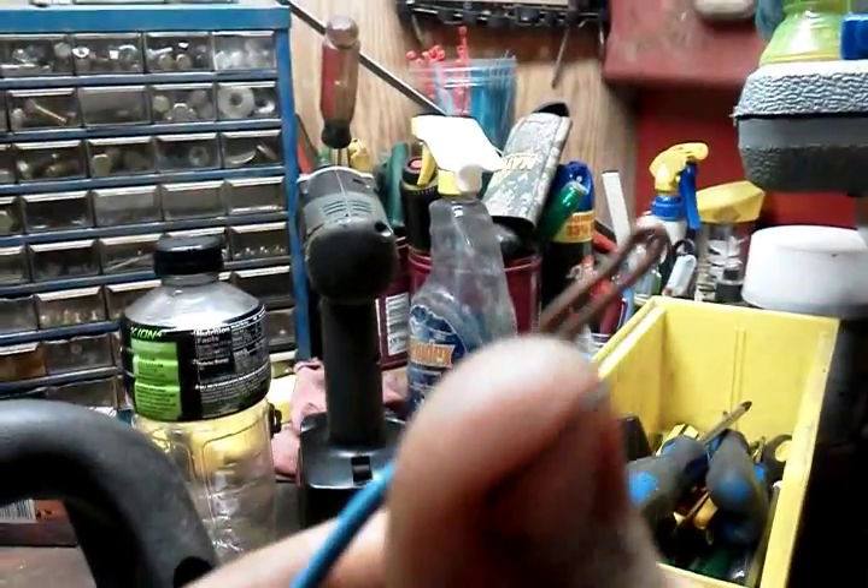I just put in both of the purge bulb lines in the fuel line. I'm gonna use my little tool — I made this. I just took a piece of copper wire and bent a hook on the end. This is for the 3/16th line, and then to make a smaller one for the 1/8 inch line. All you want to do is bend it around and cut a little 45 on that end, poke a hole through, cut a 45 on the end of that fuel line, feed it through the hole, and bend this back up as close as you can. Then just feed the wire through and out the tank hole and pull it through.